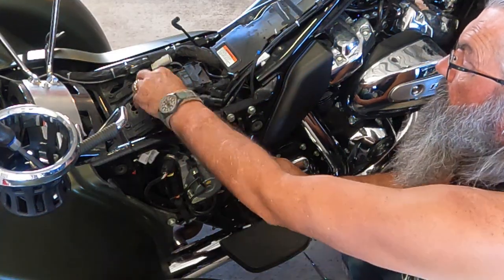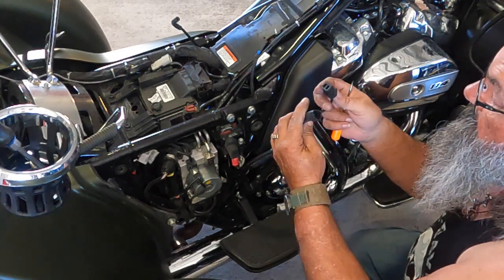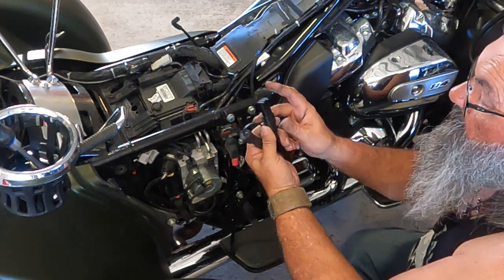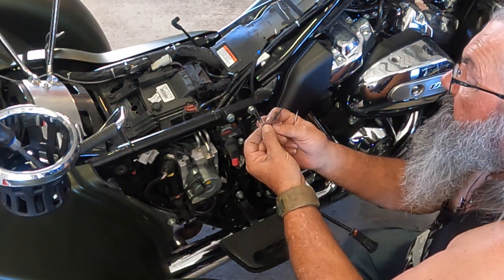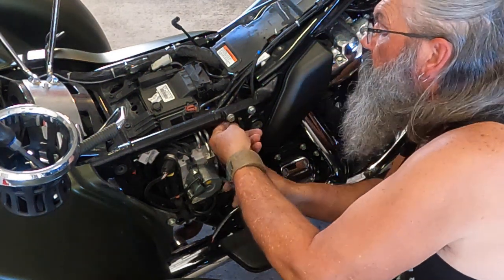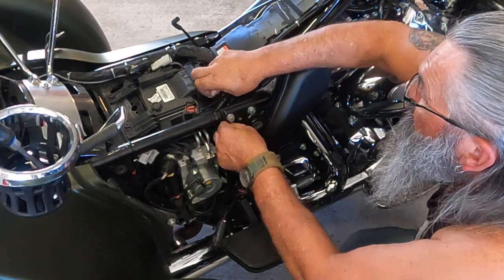The other portion you'll plug into this three-port connector — this is for different accessories like a heated seat. You're going to put the dummy plug in to keep it closed. The three wires here are: purple (which I'm guessing is ignition), then your ground, and then your positive for your battery. We're going to fish this lead under the frame and up through here, routing the grip wires down through the center tunnel to make this connection.